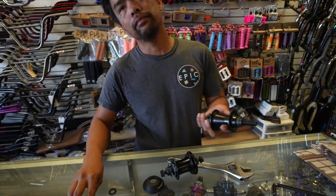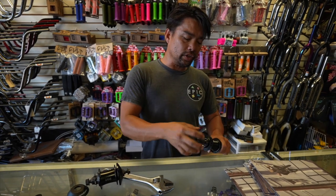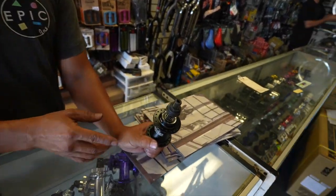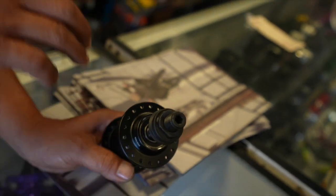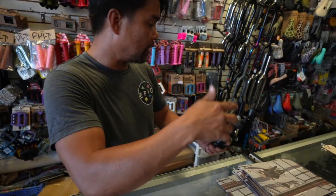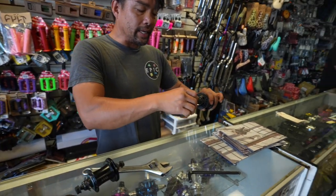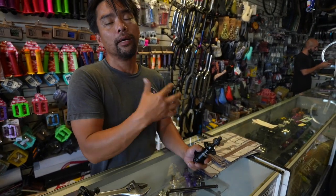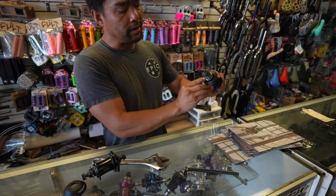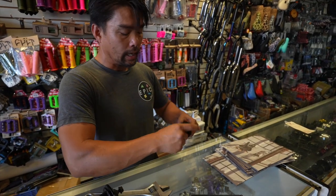How do you clean the inside? Real easy. See, that's what I need — I need some of you guys to comment like that, because sometimes it's so simple that I don't think about it. When you guys open it up, you're going to see inside is really dirty. But if you guys also notice, it's a sealed bearing, so don't go start spraying stuff in there. You're going to feel it — if it's still smooth, it's just dirty. In that case, all you do is get a rag and just wipe it. If you go like this and it's real choppy, real rough, and it's all dirty, most likely the bearing inside is gone — it's dust. Get rid of it. Otherwise the steel bearing is pretty reliable, especially on this Demolition one; they use really good bearings. So if it's smooth but just dirty, just wipe it. No spraying, no nothing, no cleaner — just wipe it down and reassemble it.